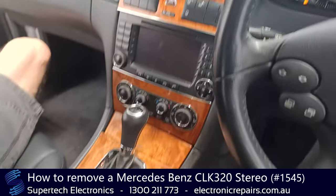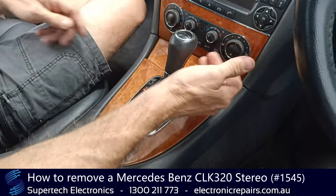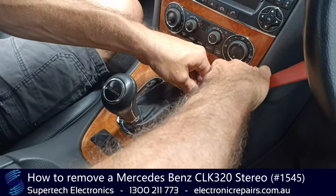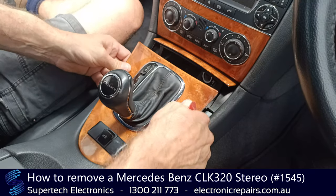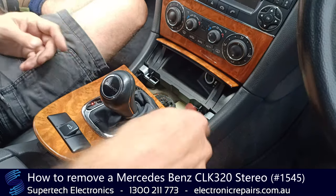Okay, let's get started. This part here is the first part we're going to need to remove. First thing we're going to do is remove the gear stick out of the way, and then we're going to just get our spudger under this — it's held in with clips and there is a little lip here — so you need to, as you lift it, move it forward and then just sit it there, just out of the way.